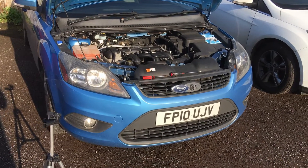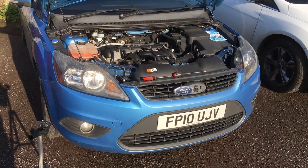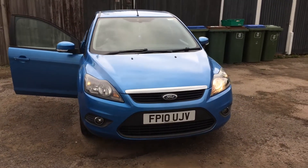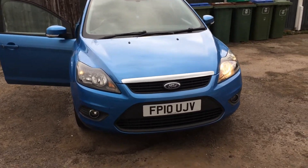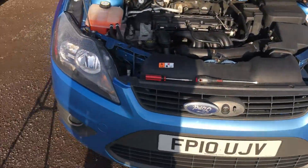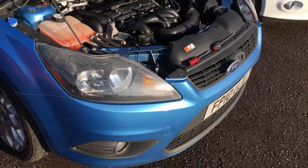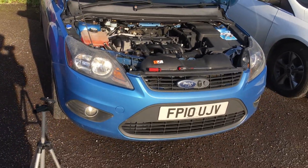Hello and welcome to another video. Today I'm going to look at the headlights. You might have noticed on a previous video, while I was replacing the bulbs on the rear lights, that every time I turned on the lights the dip beam didn't work on this side, but this one here was absolutely fine. In order to make it work I have to knock it quite a few times and actually smash it in order for the lights to come on. It could be some sort of a loose connection.